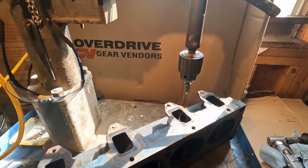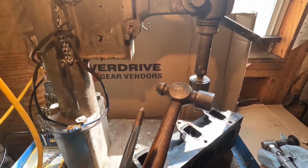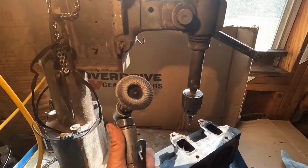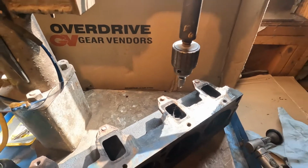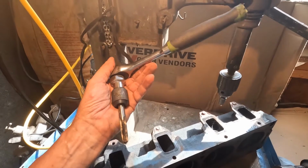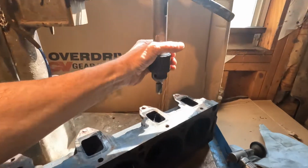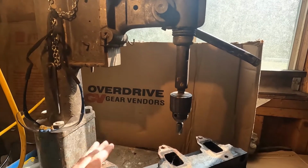With that said, I'm going to be using some drill bits, a hammer and a center punch, a little die grinder with a center wheel on it to level the bolts out better. I will also be using a tap and die once I get to that point. These are threaded for 3/8-16, so a 5/16 drill bit will be my final drill bit. Right now I have a chamfer tool in here because the last one I did I needed a chamfer to get the tap started better.